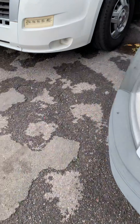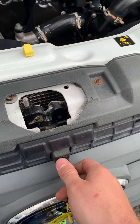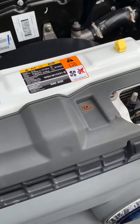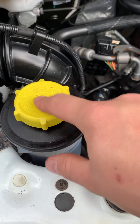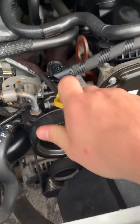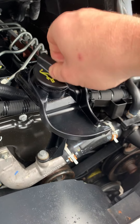To open the bonnet you need the ignition key — it goes in through this slot here, turn it to the left to release it, and turn to the right to allow it to come up. Under the bonnet you've got your brake fluid attached to the servo at the back, power steering fluid at the front, and engine oil — check it via the dipstick and fill through the top cap.